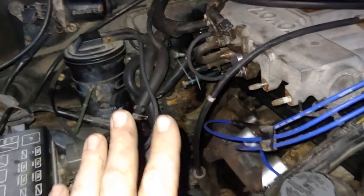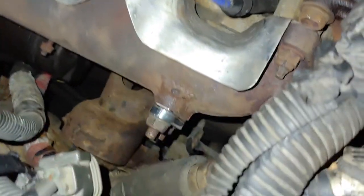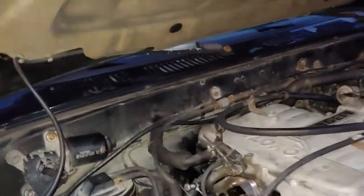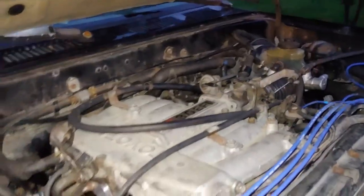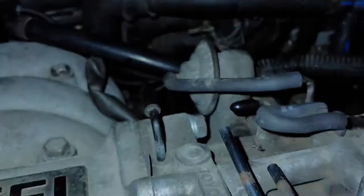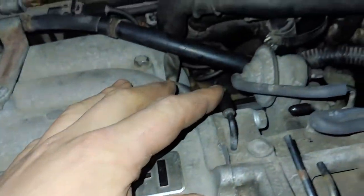So I went the route of the EGR delete. Got the LCE Performance Toyota kit — got a block-off plate there, a block-off plate down there, and a block-off plate over there. Got the caps and stuff with the kit as well. Capped off these two, capped off that one down there, removed a lot of these vacuum lines up through here, just ran a little loop on there, put a cap right there. There was nothing on here to begin with when I tore it apart.